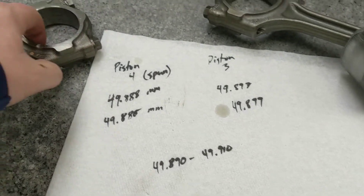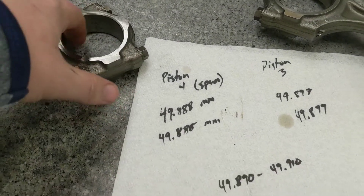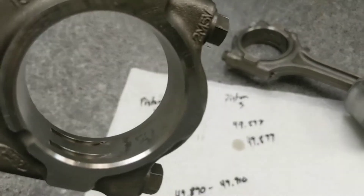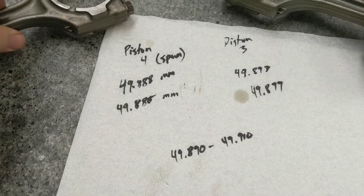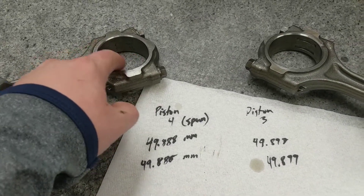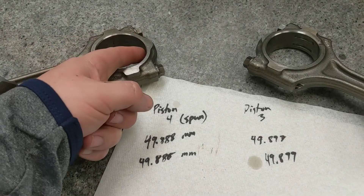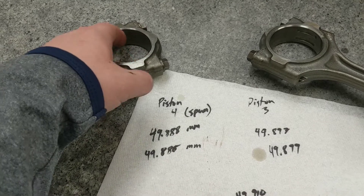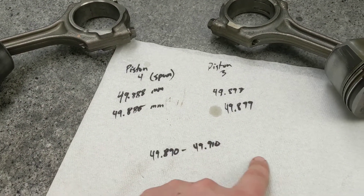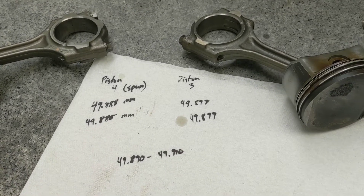I think I'm okay with it honestly — if it's undersized that's fine. It could have been some junk I didn't clean out well; maybe I was measuring on a high spot or a little burr. I don't think this rod is totally screwed. If the rod was blown out and had been hammering on the crank, there would be marks here and the number would be bigger, falling out of tolerance on the high side. That was really all I was worried about.